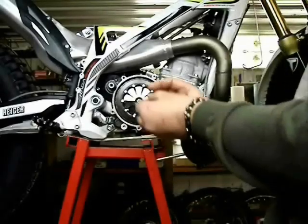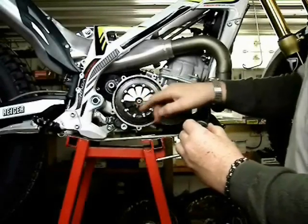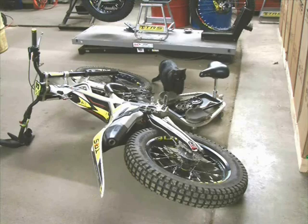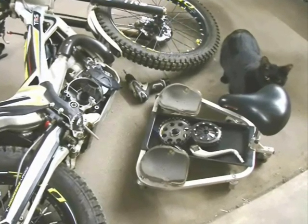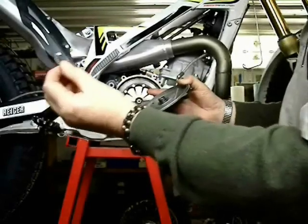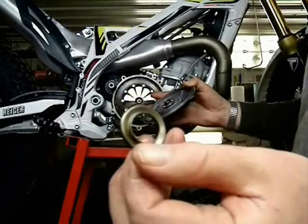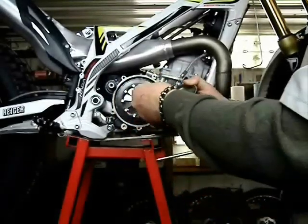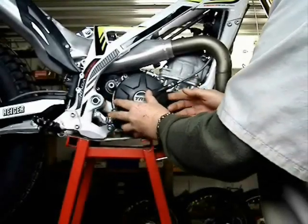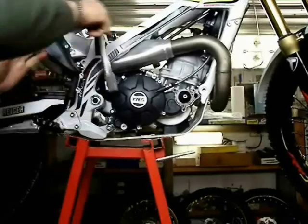Being very careful that the thrust washer and the flat bearing are properly installed, we put this cover back on. These ten fingers must be in alignment. It might be better if you laid the bike on its side — some people prefer that because gravity holds the ten fingers down. You place the flat bearing first onto the slave piston and then the thrust washer, which has one side that's machined. The machined side goes toward the bearing. Then, being very careful that the o-ring is still in its groove on the cover, we can very gently manipulate it into place.